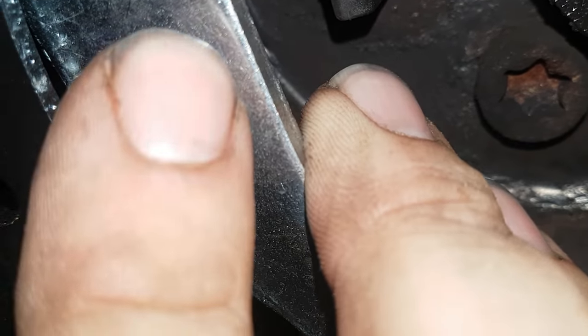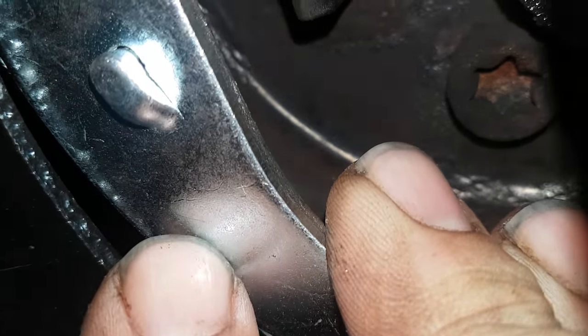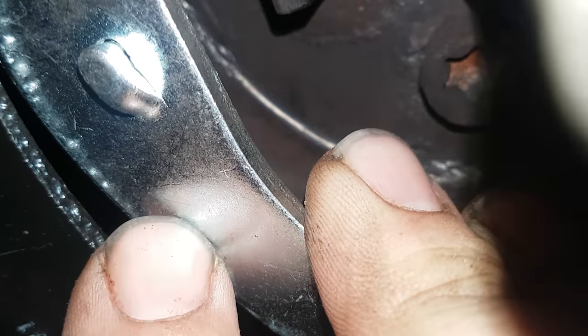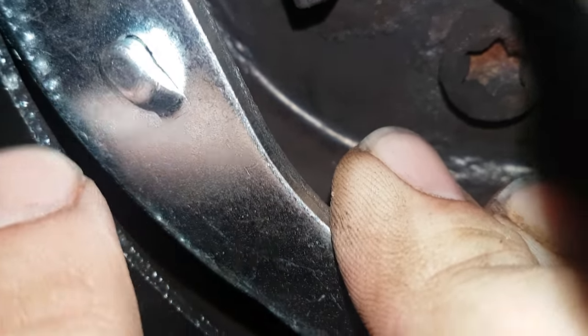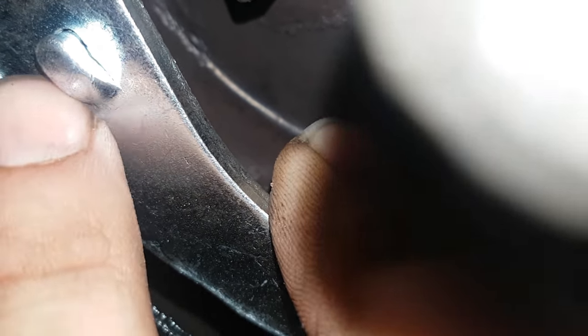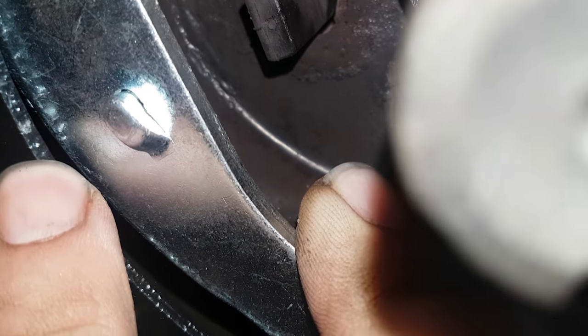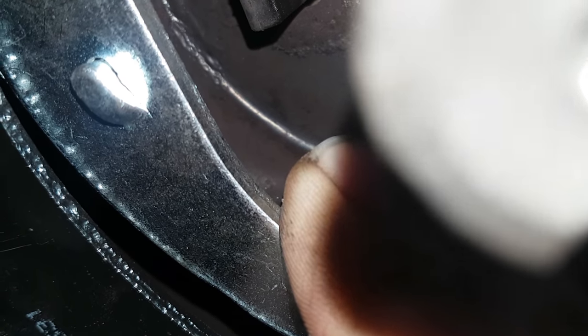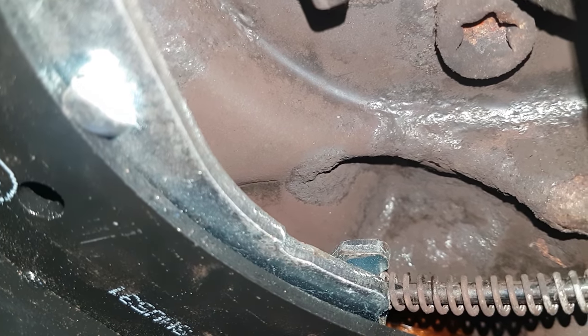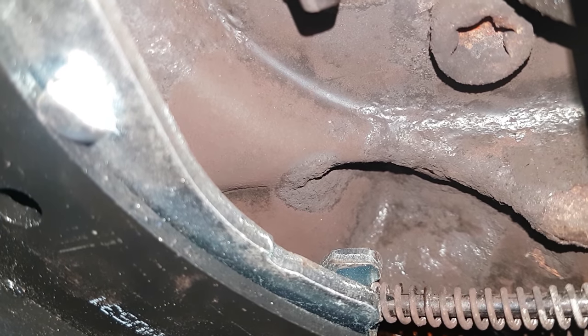To give you an idea: this is the brake shoe, and as you can see I haven't slackened off the handbrake yet. We need this notch touching there — that's how you want to start adjusting these properly, and as you can see we're miles away because the handbrake cables have been adjusted that much. Once that goes back to there you can adjust them properly. Right, you can see that is now touching — we are ready to make our proper adjustments.